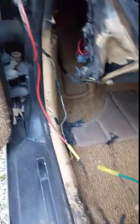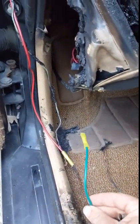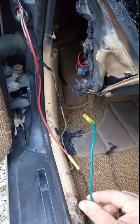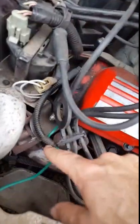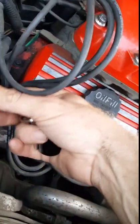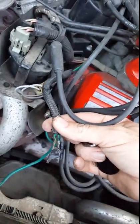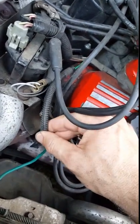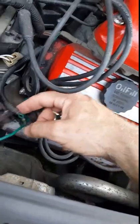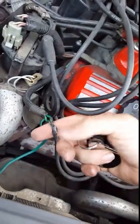But so David says he put this wire in, I believe. I might be wrong, but this wire was for a switch or a gauge. And you can see right here where he had it wired up to where the factory gauge was. Unfortunately, he disconnected the factory wiring and let it sit down there on the hot exhaust manifold and melt the connector. So when I put that back to the way it's supposed to be, I'm going to have to put a new connector on there.